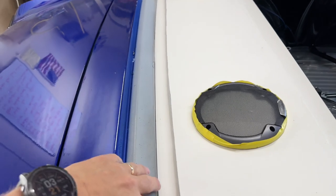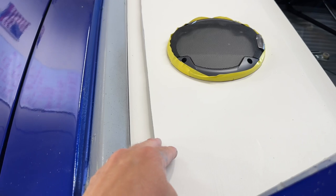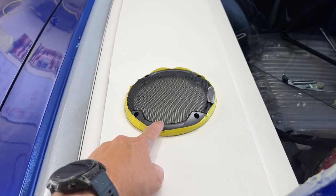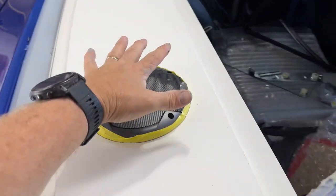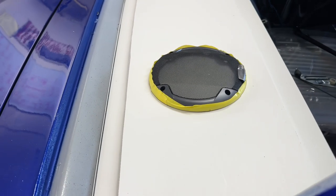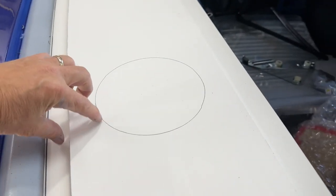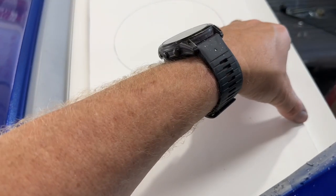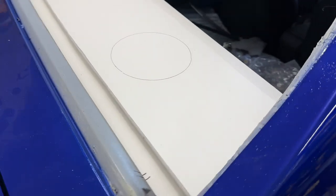Kind of make it three-dimensional, which will give it a lot more character when you look in there. The window will be here, then there'll be a little lip, then a gap — this section will be a 45-degree bevel, and then my speaker is going to be countersunk in there. That centers up with where the original speaker holes are. I put tape on it so I don't mark the speaker grills, and these are going to be countersunk. I want to make the gap noticeable, where you know it's intentional.